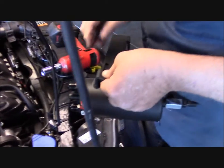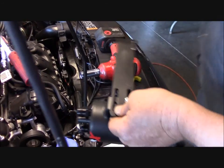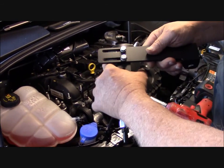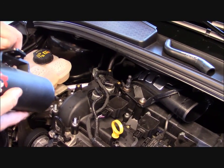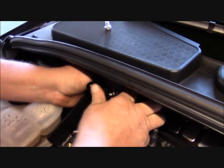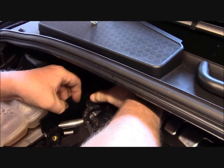The goal here is we're going to stop the oil injection that's creating the intake valve coking. And we're going to improve fuel economy and horsepower a little bit by not having this oil vapor contaminating the intake air charge, where we only want air and fuel present. So, we're going to start our mount bolts first. This will slide to adjust as you need. We're going to slide this back into this tight little section here, and it looks like I'm going to have to do it with one bolt to begin with, so we can get the can down into place.